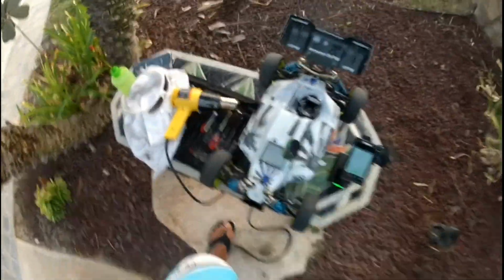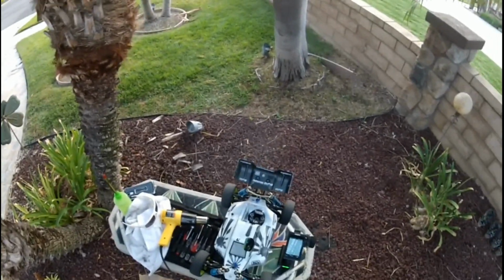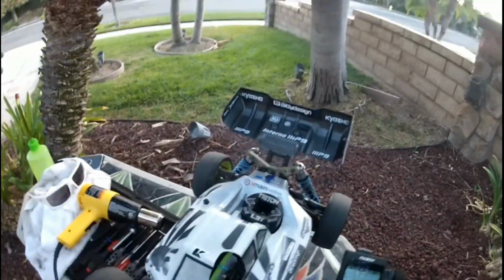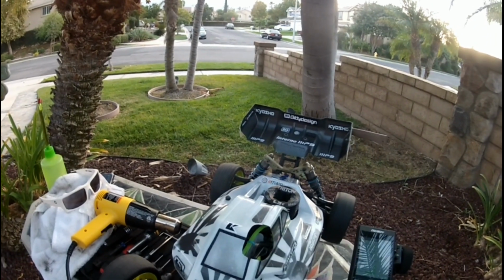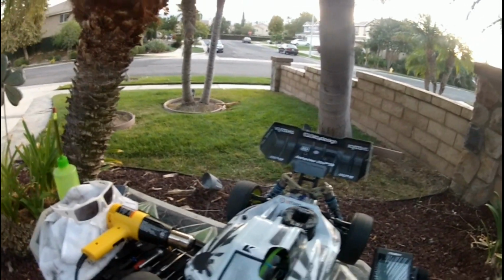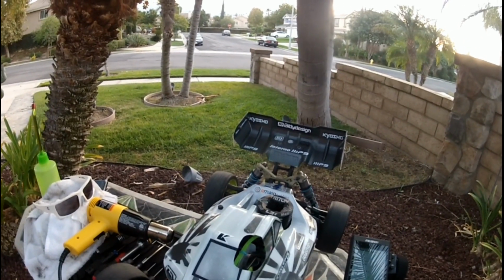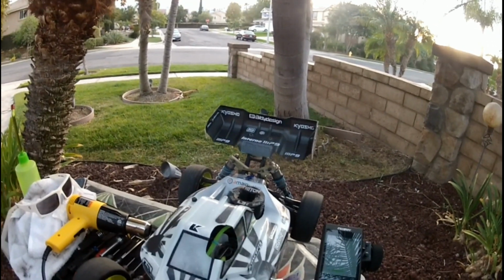We are at tank number 8. So this is where you do what you want. This is where I start doing full pulls. We're still on 2016 Byron, so she still is running pretty rich. You'll see in a minute. But yeah, so we're on 2016. I got a kind of a semi-box tune on it, but I'm not really going to start messing with the tune too much as far as dialing it in till after this tank.